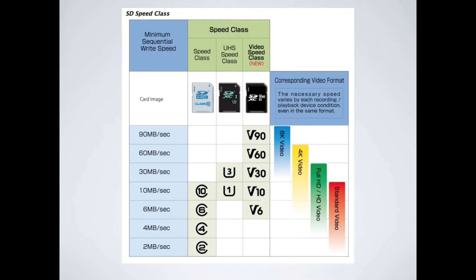Looking at speeds on cards, this gets a little bit complicated because there isn't an easy standard measuring method used and the SD classification system has jumped about a bit. The basics are, as shown on the screen, all cards at least 10 megabytes a second are classed as Class 10. So whatever card you're going to want, you must make sure that it is a Class 10 card.